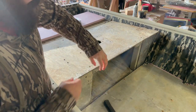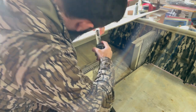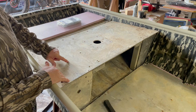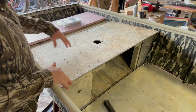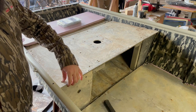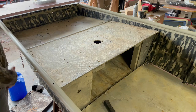This piece right here is some super heavy-duty aluminum — it is quarter-inch thick. That's what they had on here and that's what I'm going back with. You can tell it still has some glue on it and some high spots where they drilled through it over time. I'm going to clean all that up before I put the hydro turf in. I'm not attaching it yet — they already had it countersunk for screws and I'm going back with rivets — so whenever they come in I'll clean it up and pop it in place.